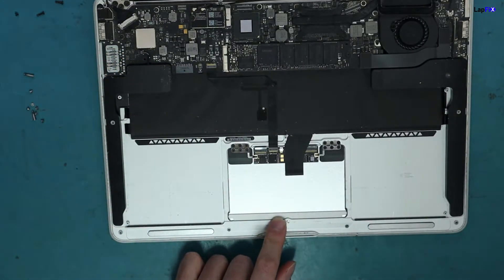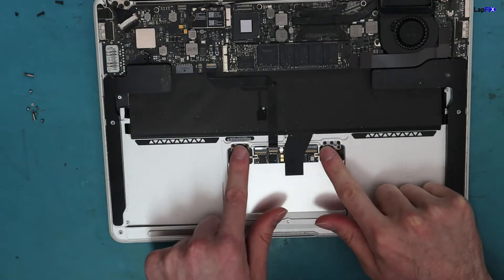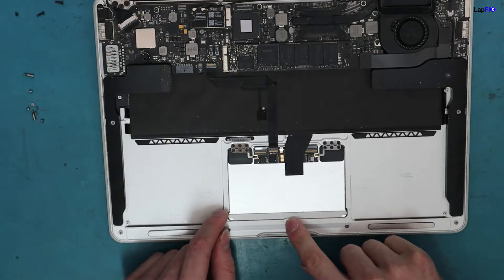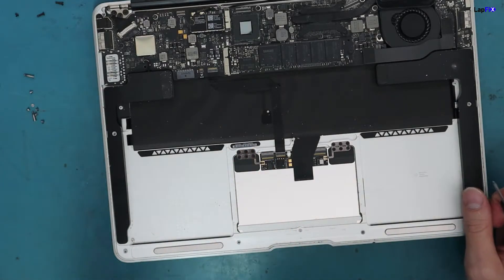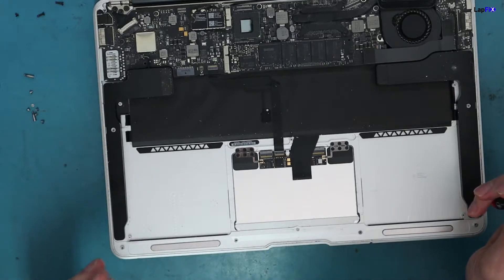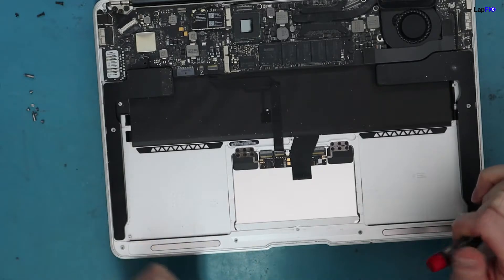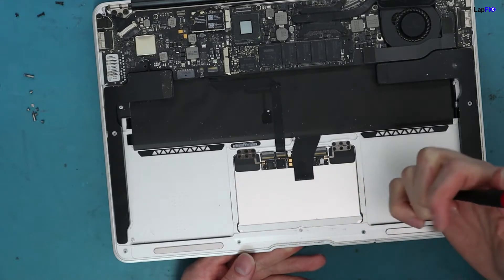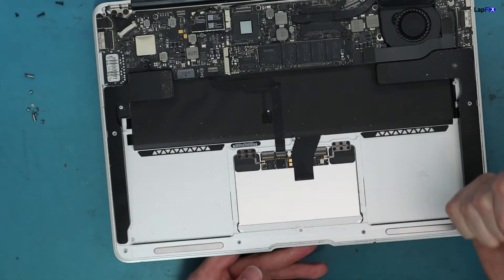So what we're left with would be this screw here. The worst case would be having to replace the trackpad — there are a bunch of screws and it's very easy to strip them. But for the click issue, maybe this little screw right here came a little bit loose. Because this has actual components on it, it's very easy for this to go bad, especially on the 2011-2012 models. The components are actually on the trackpad itself in this model, so if you have any trouble with it clicking beyond this type of issue, you may just need to replace the trackpad.